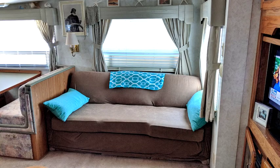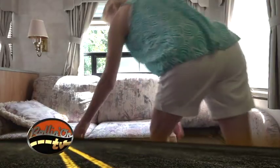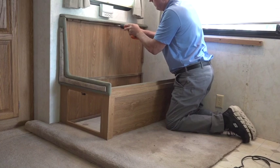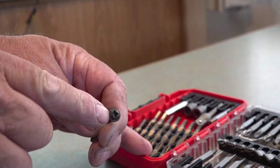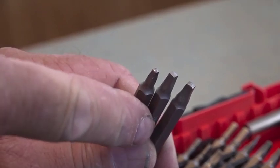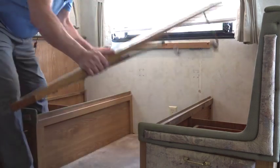The first step of the interior upgrade project was to remove the old furniture and the dinette booth, which will give us better access to remove and replace the old flooring and shades. When you remove RV furniture, start by removing all the cushions to see how the furniture is secured to the walls and floor. Using the correct tool, start removing all the screws and other mounting hardware. Screws typically used in RV construction are either combination screws — square and Phillips head — or just a square head screw. Square or Robertson bits come in three sizes, so use the correct size bit to prevent stripping.